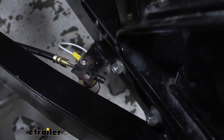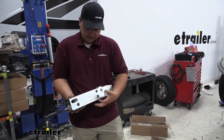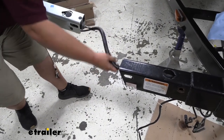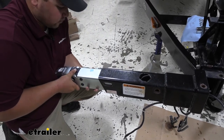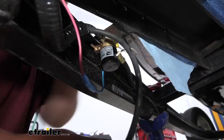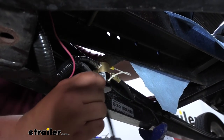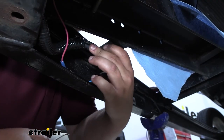After our ground wire's secure, we're going to install our actuator and run our line to our lockout valve. Our next step will be to install our actuator — we want to remove our pins on the front and back so we can slide it into our trailer. So we're going to make sure to hold the bottom so the piston doesn't drop out. I'm going to take our hoses and put those through the end of our trailer and feed them through the other side, then carefully slide our actuator into the hitch. You might have to wiggle it around a little bit, and if it's not wanting to go, you can come to the back side and pull your hoses. After you've installed your tubing, you're going to come back through and cut your breather valve tube. We'll cut it right about there, slide that back onto our breather valve, and then you're good to go.